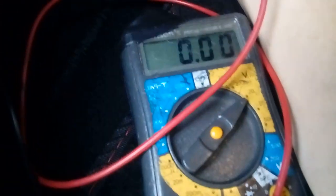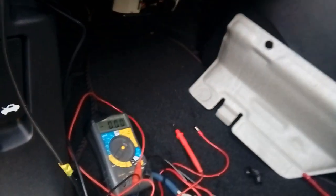With our screwdriver, our test probe, earthed out, we'll go down here. Touch it again and get a contact. Bear with me. Very tricky doing it. There we go. Tricky doing anything one-handed. My connection's not very good. There we go. It's making a liar of me, isn't it? It's this earth. I've wedged it under the rubber, and it's moving a lot as I'm trying to do it, but rest assured that's 12 volts with the ignition on.